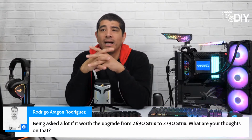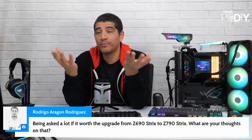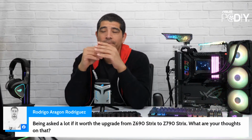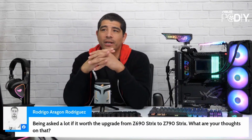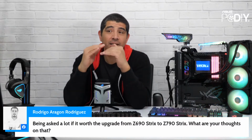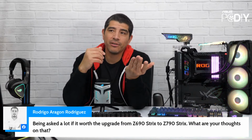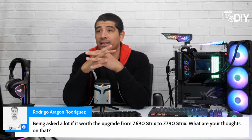But even that, I actually have a full post on this that I've already done for the PCDIY group. So if you're part of the group, you can read that post, and it actually talks about this. And pretty much what it means is that if you're trying to target higher frequency memory, you can get a little bit more margin, a little bit more headroom on a Z790 series motherboard. But if you were to take a 13th gen series processor and run it on Z690, you'll still get an uplift in terms of memory target. So an example is, in the prior generation, 6,000 was generally the new normal. About 7,000 is roughly the new normal for a Z790, right?